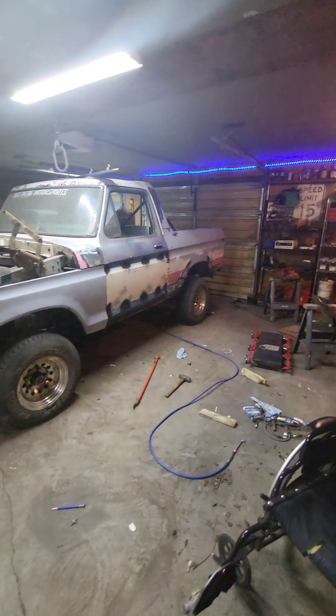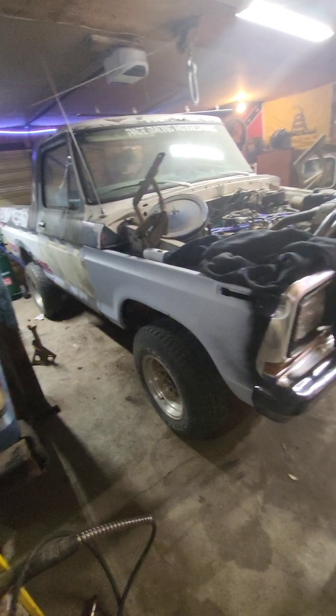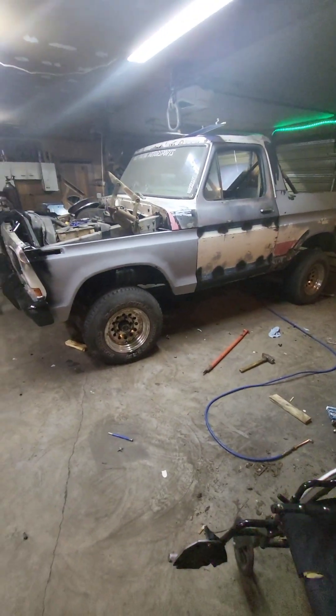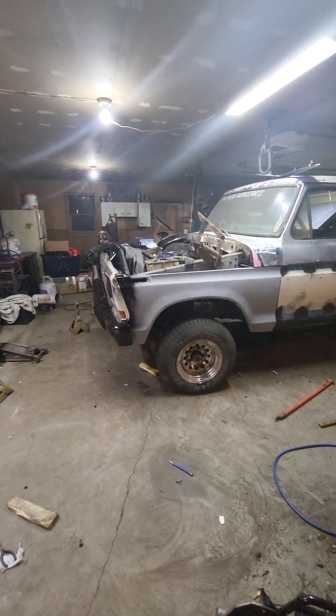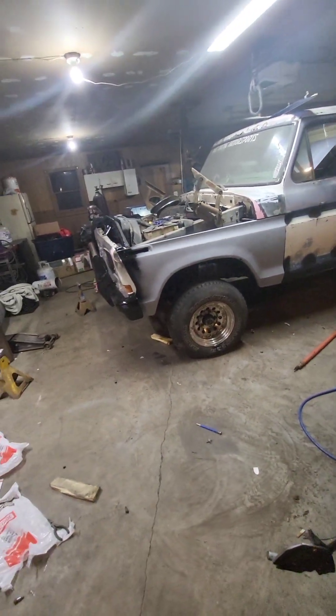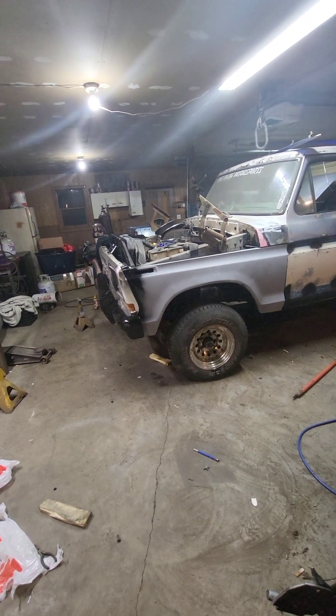She's back on all fours for the first time in three months. It took about an hour and ten minutes to pop the bead on all four tires and put tubes in all four tires. The yard tires are on — this is a factory stance. There's like a one-inch spacer on the front, but these are 235/75R15s — same tires that came on it from the factory. This thing will eventually have 33s, and the front end will be lifted about two more inches. I'm going to take out the existing lift and put a three-inch lift in, because mixing lift components is goofy.